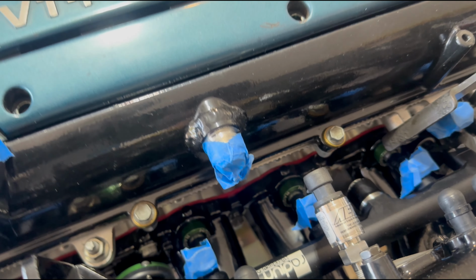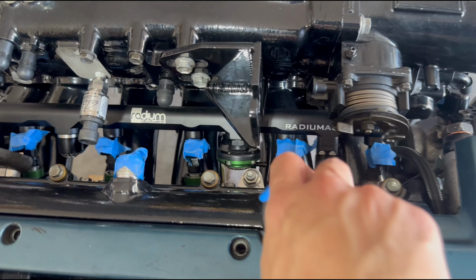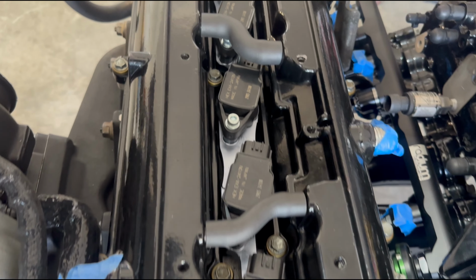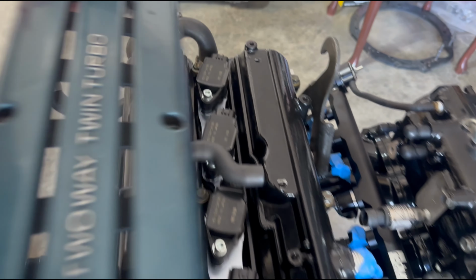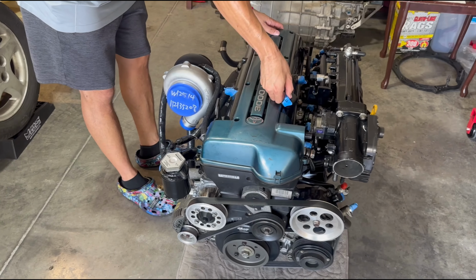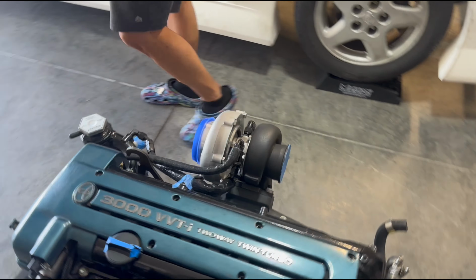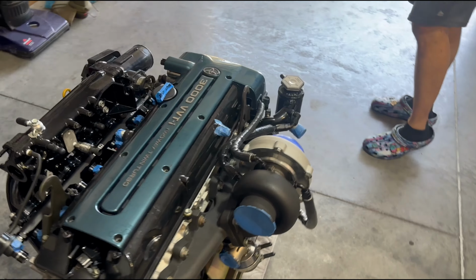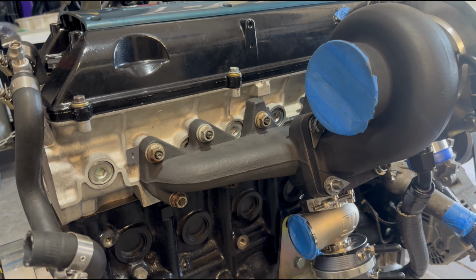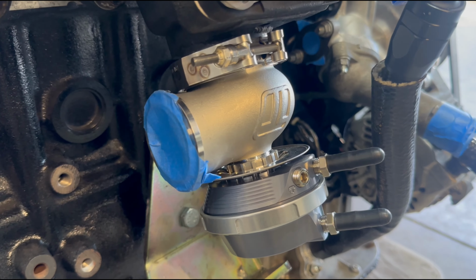And then going standalone this time around. Oh, and then R35 coils from PRP. Yes, sir. And Turbo Smart wastegate. Pretty much it. All the coolant lines, oil lines already run. So pretty much ready to drop in once I put the transmission on. This one was a mild manifold? Yeah, your old manifold. Your old cast iron manifold.